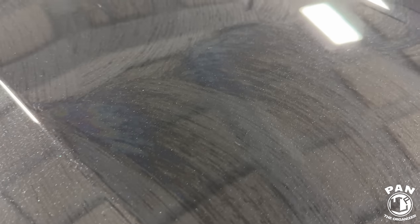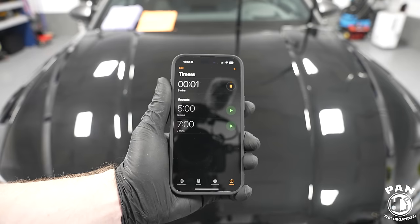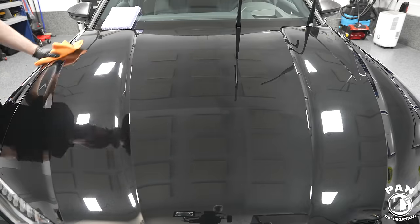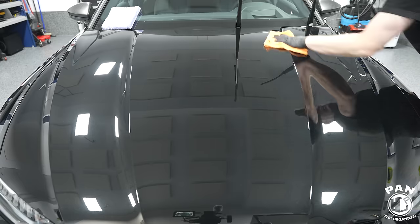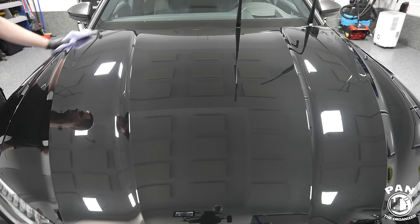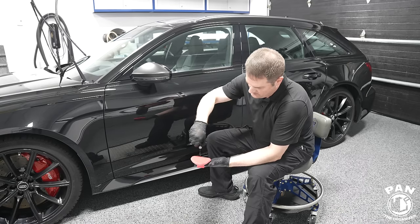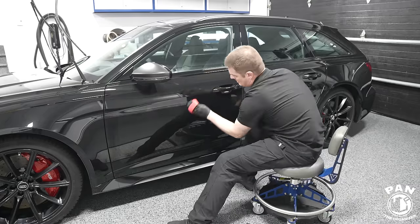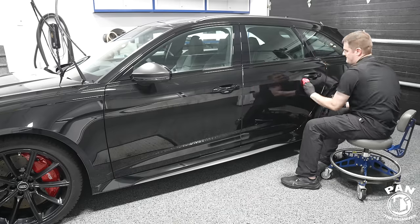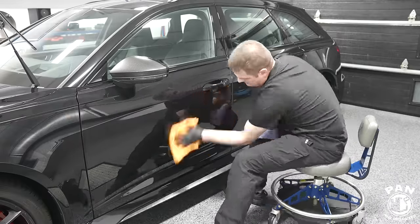This coating contains silicon carbide, silicon nitride, polysilazane, and SiO2 or silica. Polysilazane is hard, durable, flexible, and resistant to abrasion. SiO2 or silica is used for gloss and slickness. Silicon carbide is extremely durable with chemical resistance and great gloss. Silicon nitride reduces fracturing — resisting hot and cold cycles. To level the coating once the time is up, I use a short-nap towel — the Rag Company Pearl towel — to level and remove any solvent carriers, making sure there are no high spots. I then follow up with the Rag Company Eagle Edgeless 350, a plusher towel, to pick up any residual material.